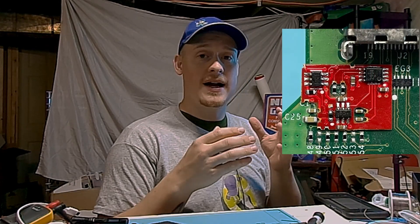I did this repair back in February — it is now June, and I just recently texted the customer saying I still have your base plate because I forgot to put it on, and asking how's your Xbox working. He said it's still working great. So the bypass has worked, it's holding up, and nothing has been fried. Currently there is a PCB in the mail on its way to me, which is going to help rectify this problem in the future. A gentleman by the name of Thomas, who is also on the Repair Legion Facebook group, has made a PCB that is an alternate to the booster chip. This PCB will be a safe alternative for the Series S, X, or Xbox One X — providing overcurrent protection and translating the 3.3 volts to the 5 volts on the other side with no damage either way. This is great for the repair community because there are tons of Xboxes out there that can't safely be repaired, and now there is an option. If you need that PCB, there's a link for Thomas' website, Tech Time with Thomas, down in my description.